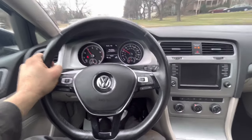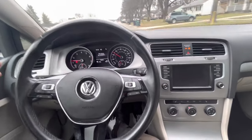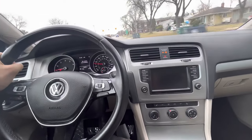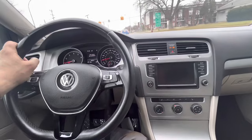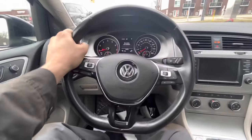The whole car shakes. It almost feels side to side — it's a slower-paced, cyclic kind of vibration. You feel it through the whole thing; you can feel it in your back and your steering wheel, everywhere. And as soon as you get off the gas, the vibration goes away altogether. It just completely smooths out.